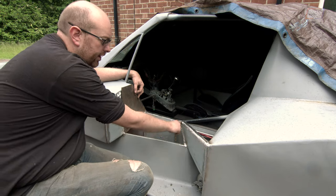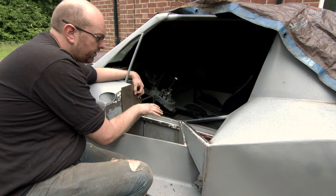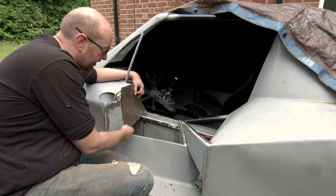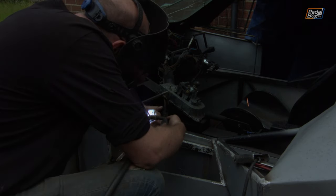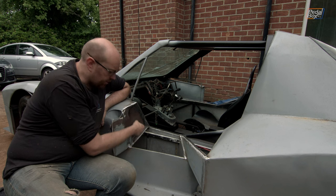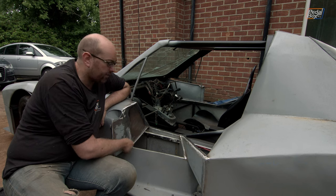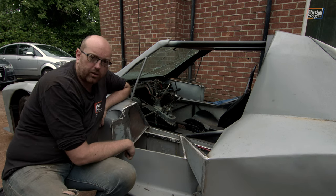I've finished off and cleaned up the whole panel at the back, and I've welded in a little drip tray just down the side - just another piece of the 0.7mm steel welded in at an angle so that when the closing lid goes over the top, whatever falls down the back will come out of the car and not drip into the compartment inside. While trimming the new panel to fit, I noticed there was enough material on the bottom that if I just shimmied it down about a quarter of an inch, I had easily enough material to fold around and build a drip channel directly in - way easier than welding on a tiny thin bit of steel.